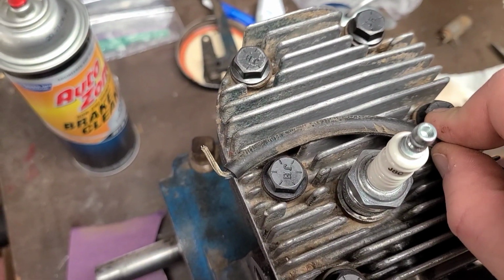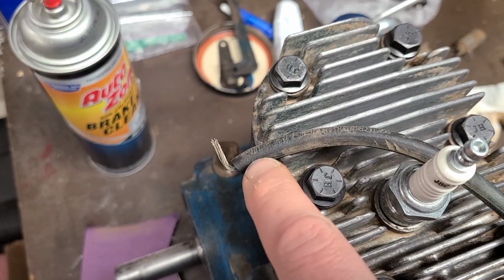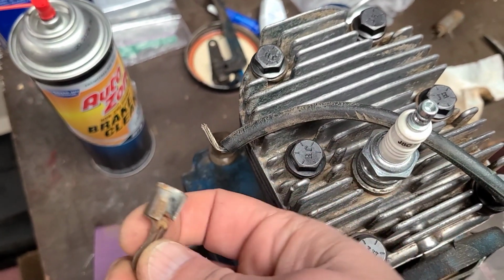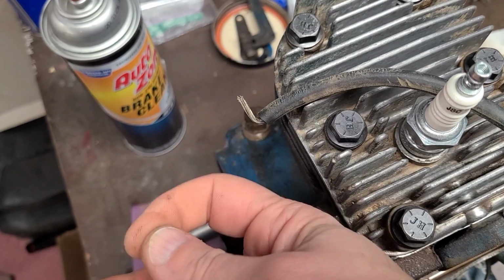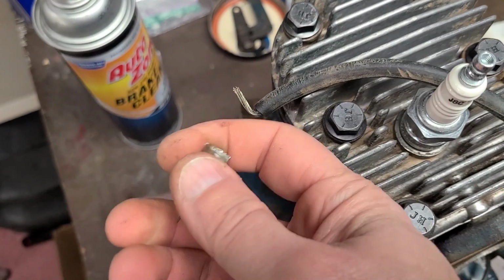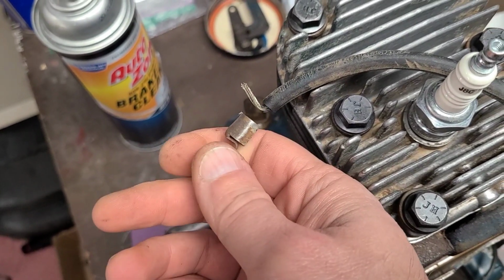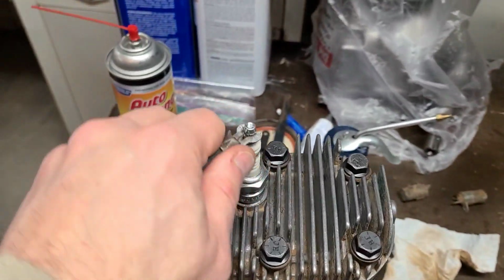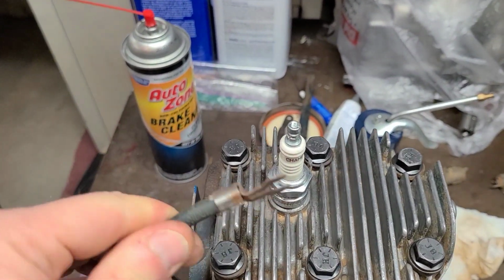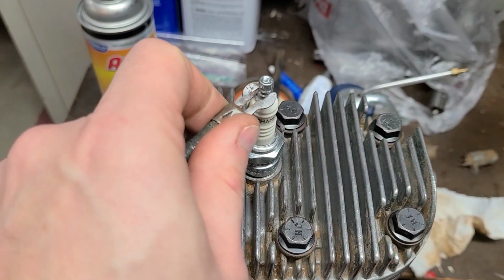So I just removed that sheath. I'm going to bend this inner core up and over the outside. Then I'm just going to take the end, put the end in this position with the core kind of sticking out to this little spike. I'm going to press it all into place and then crimp it down with my pliers, and that end should be on. The ignition wire is all set. It's crimped on real nice. You see it fits real tight. Almost looks factory, but it clips on real nice.